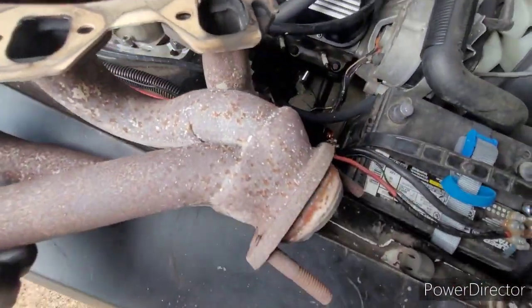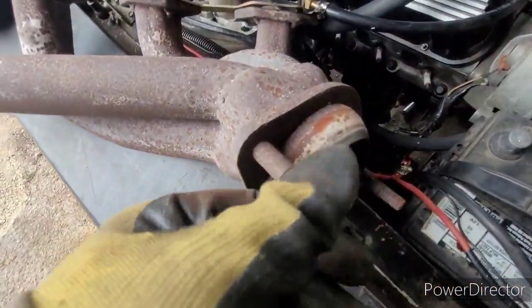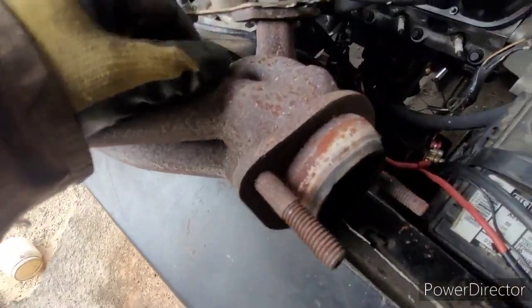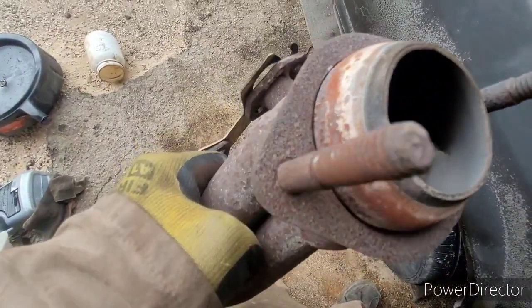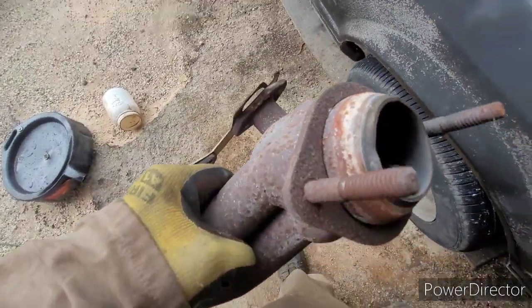All right. Well, sure wish my new exhaust gaskets would get here. This header, also salvageable, not horrible. I'm going to try my best to get these studs out and buy replacement bolts so I can bolt in both sides. I hate these studs. Putting them back with a stud is a nightmare also. This is the usual culprit on these short tubes for me, but it does not appear it was leaking here on either side, so that's good news. The H-pipe is still holding.